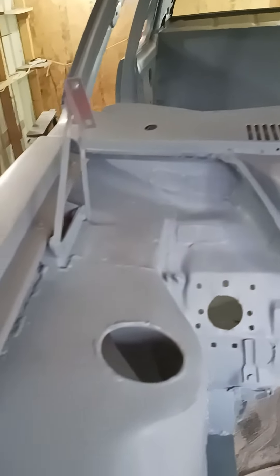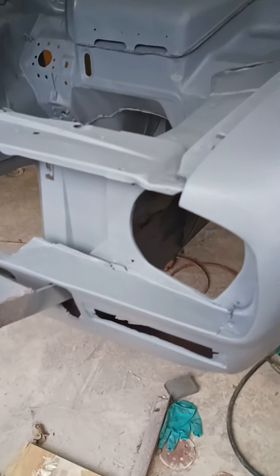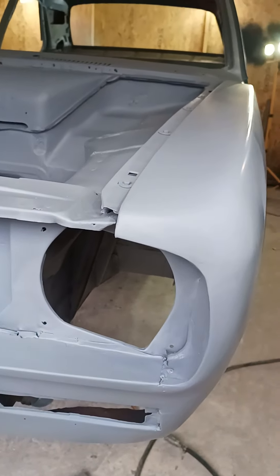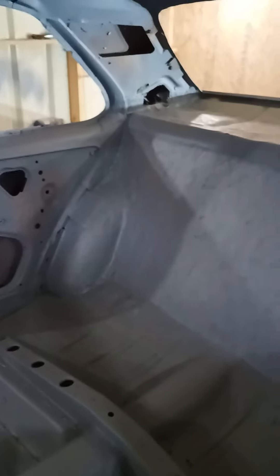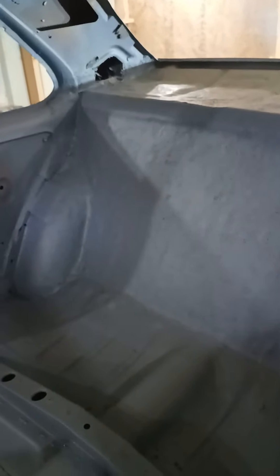These wings are actually new Series 7 wings. I cut the old Series 6 sections off here and grafted them on at the wheel arch, so we still have the Series 6 headlights in here. The rear is fully fireproofed with aluminium sheet and then fiberglassed over — makes a good solid job.